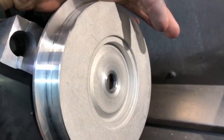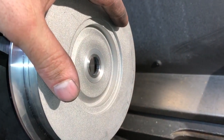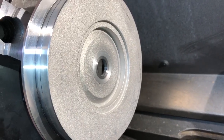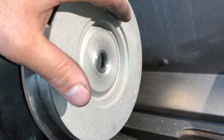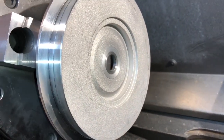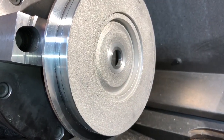There are two different plates — the H1C and the H1E. The H1E is a little bit more than 83 millimeters for the compressor wheel, around 82 or 83. The H1C, I can't remember the exact size — I think it's probably about 78, though some of them are 82 depending on which H1C you have. Anyway, I'm going to machine this out to fit the HX40 86 millimeter.